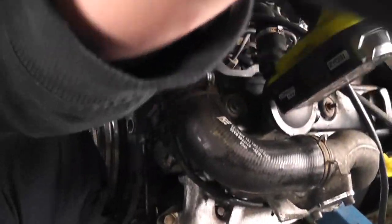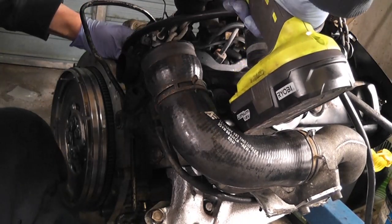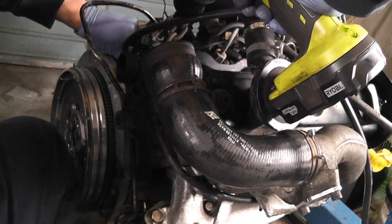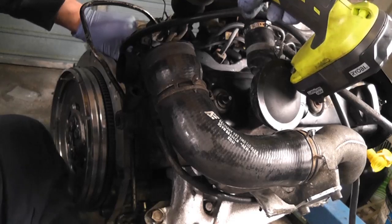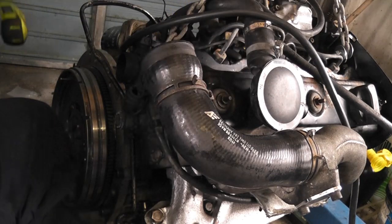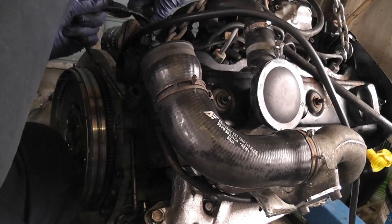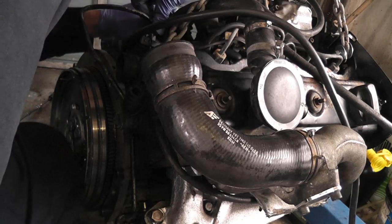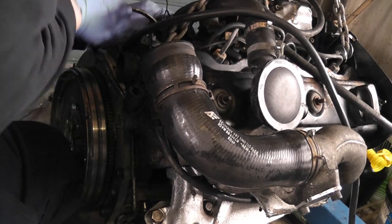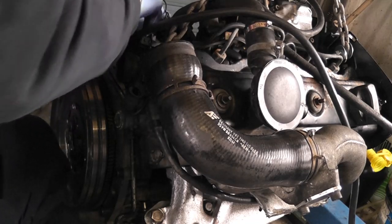So we'll be back and we'll give it a spin. That's working a treat now. Feels like it's doing something now anyway. Oh, okay. We're getting oil up out of the turbo oil supply now. In my infinite wisdom, I took that pipe off to get access. Not my brightest move. Ooh, that's disgusting sludgy oil coming out of here as well. So I think what we'll be doing is flushing this oil out as soon as we get the engine running.